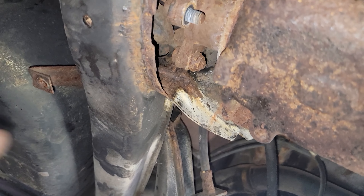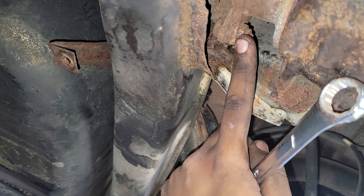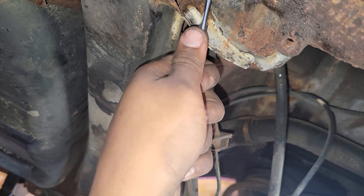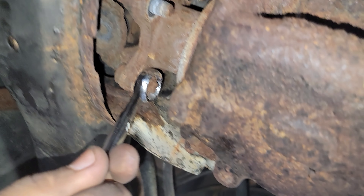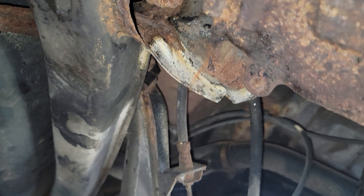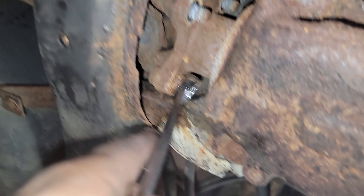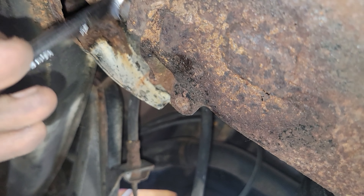So I put the car in neutral. I got to where I can get the fourth bolt or nut off. Now when you get it in position — kind of like in the middle — I can move it freely. But you want to be able to get it off, so what you have to do is put it back in park. Then it's stationary where it is, and you're just fighting basically that park gear holding it for you. Just make it easy for yourself.